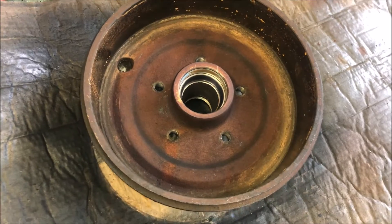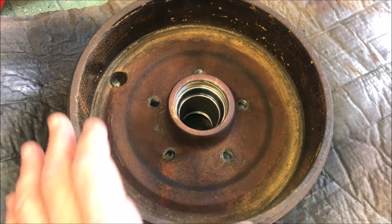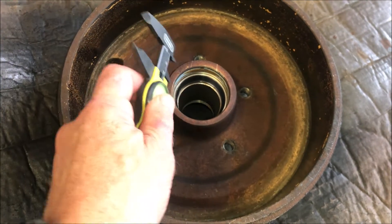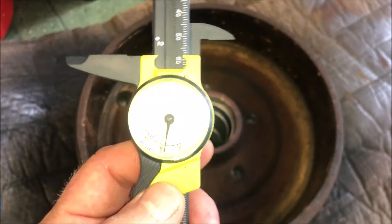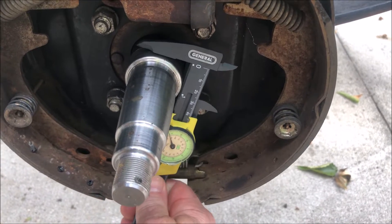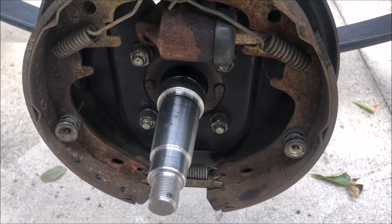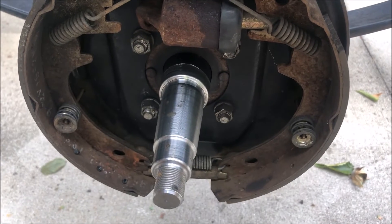In order to thoroughly clean the hub, I had to pull the seal out. That seal was right here to get that bearing out so I can clean the bearings, clean the hub out, and make sure that there's no residual old grease in there, because that would not probably mix well with new grease. The problem is getting a seal for this hub, and it's actually pretty easy. What I did is I measured the inside bore here, and that came out to 2.33 inches. Then I measured this surface here for the inside of that seal, which came out to 1.68 inches. I went on Amazon and found the 2.33 by 1.68 inch seal and ordered two of them for ten bucks — can't beat Amazon. I'll link those in the description below, but you ought to measure them yourself; those may work if you have a similar hub.